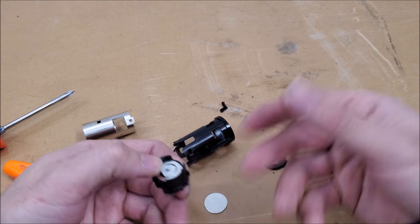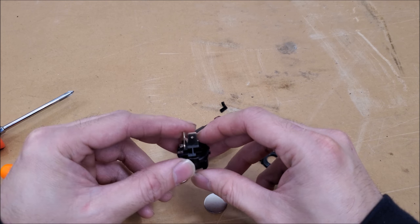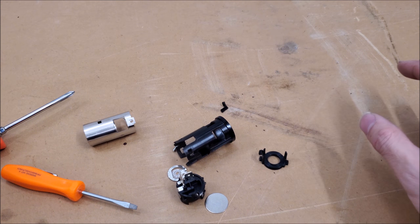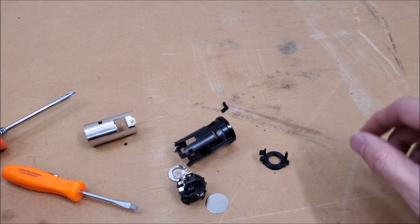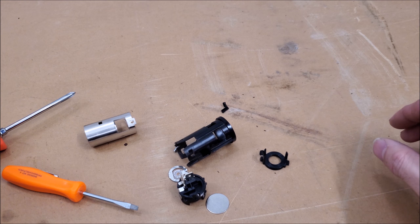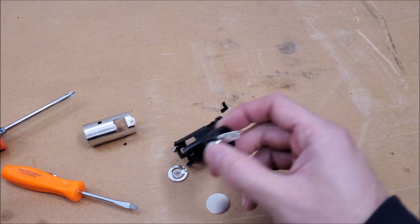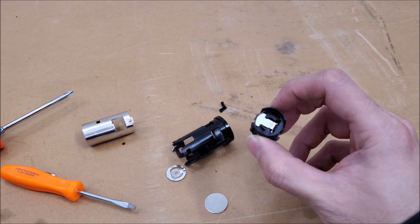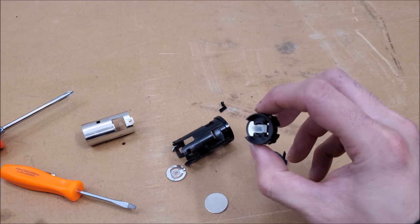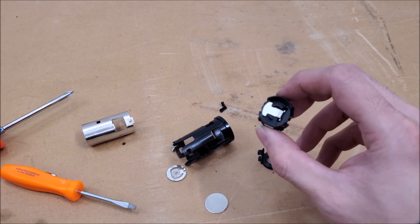Don't try to sand this or solder it together, because you're kind of defeating the purpose — you're not doing it how it was engineered. Because for all we know — I have not inspected the circuit of this car — there are two power ports or cigarette lighters in the car: one in a little cubby hole, one in the center console. They could be sharing the exact same fuse rated at like 20 amps. These are probably rated at 10 each. So it could be that the manufacturer, instead of running two fuses to the distribution panel, decided to do one, and then this is now the fusible link. There are a lot of different reasons why they're doing what they're doing.